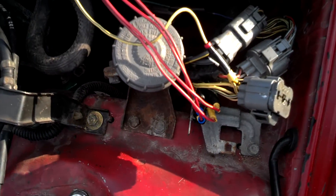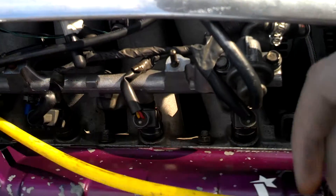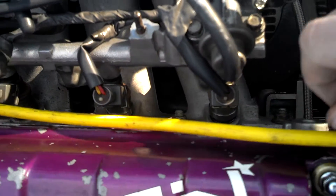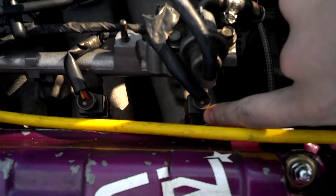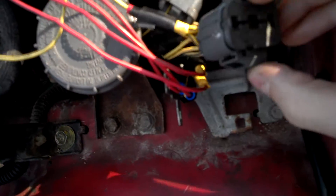The easiest way is by using a multimeter. What you do is each injector — you have the pigtail. You take the pigtails off, and you do a continuity check with a multimeter. It's usually going to be the right wire on each injector. What you do is you hook it up there and pull this little cap off.